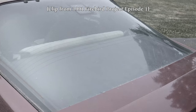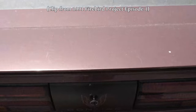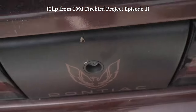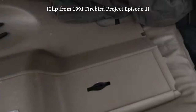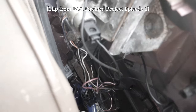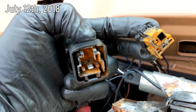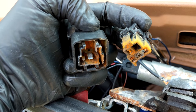All the way back in July of 2018 when we first bought this car, the hatch assembly was just barely working. You could pop the hatch up with the key and then kind of lift it by hand - the motor would come on and off a little bit and eventually you could get it open. With the hatch open you could wiggle the wires around and get the motor to fully descend. A cursory examination of the wiring revealed some pretty obvious faults - first up, the relay and its connector are definitely not supposed to be full of rust.